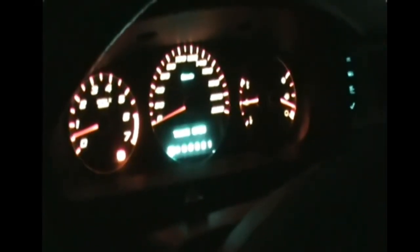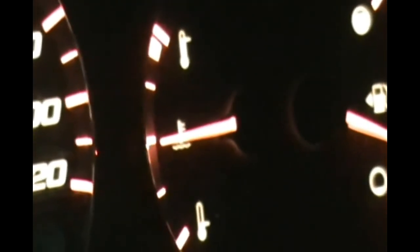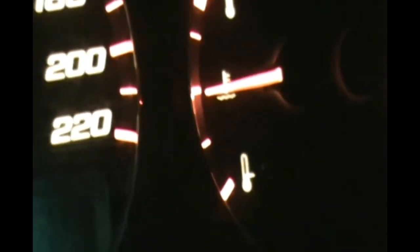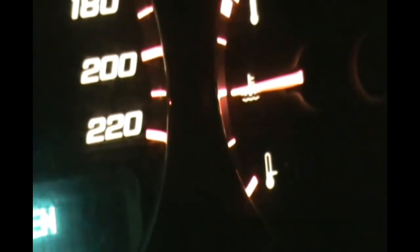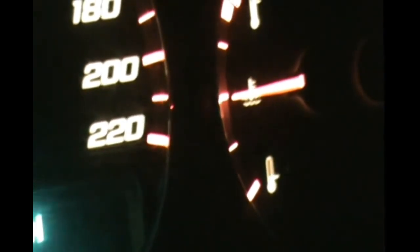So there you have it. My gauge here is exactly on half. That's Impala SS. It'll stay there. It'll never go higher. If it goes higher, that means there's a problem. And I have the heater on and it's really, really hot right now. And I'm gonna go check the water level and it should be fine. If I need to top it, I'll add more.